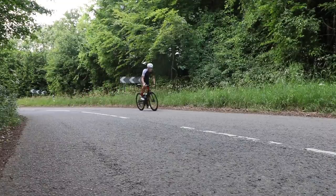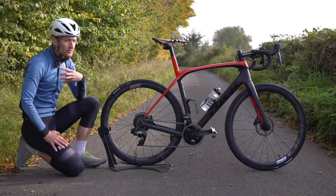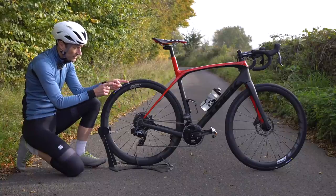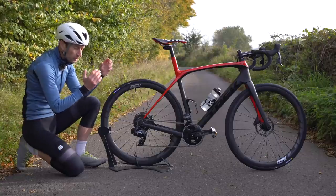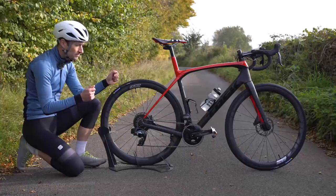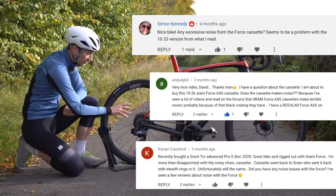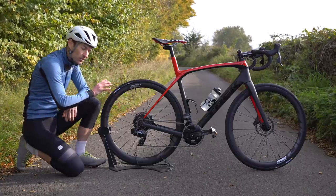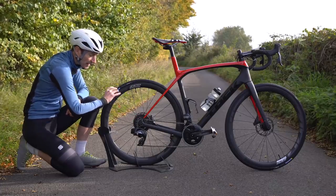The performance of the groupset over four months has been really good, with one exception right at the beginning — a dropped chain. I was descending a hill and getting ready for the climb after it, and on quite bumpy ground in between, I switched gear and the chain bounced off the inner ring and got stuck between the frame and the crank. That was the one exception to an otherwise flawless groupset. Shift quality is really good — if I'm being finicky, it's not quite as sharp and fast as Shimano Di2, but you don't notice it at all once you've been using it. I had lots of questions about cassette noise, but this cassette has been really quiet with no issues at all. They've added extra rubber rings between some sprockets and it's been silent in use.